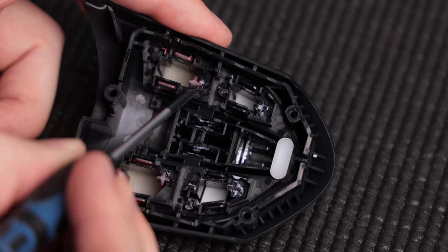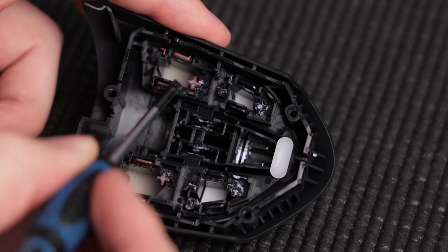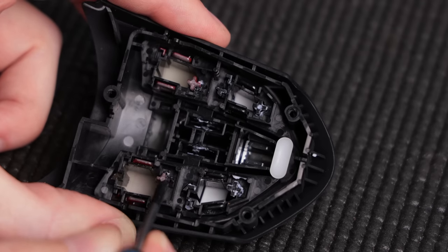So when I first popped the buttons in, I noticed that the action on them was a little stiff. And then when I looked at the backside, I noticed that the original stock buttons had some lubrication on them. So I just took a little tiny bit of Vaseline on the end of a screwdriver and lubricated the back of the new buttons where they slide. They feel a lot better now. So you might want to try that if you're going to do this at home.